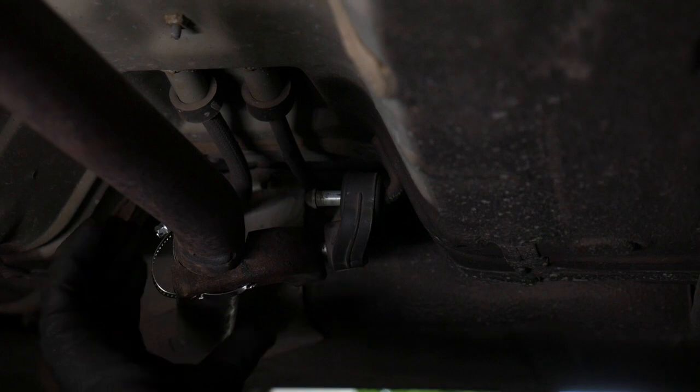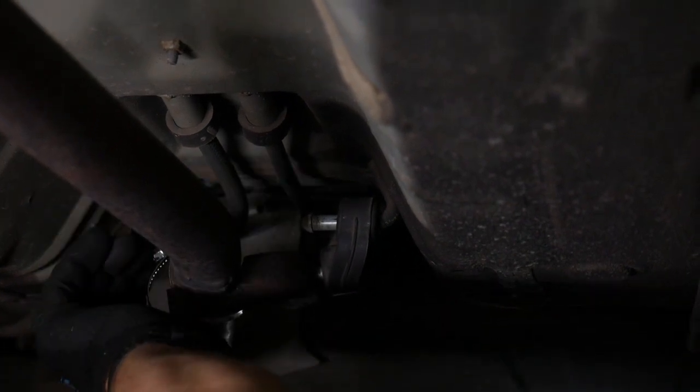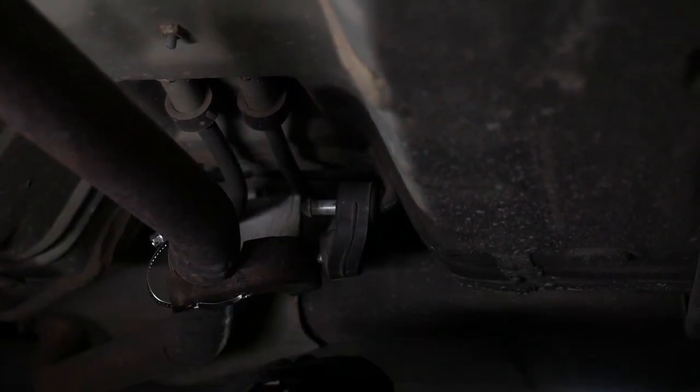The clamp is obviously made out of metal so it's not going to melt, and I think it's going to last a lot longer than the original bracket. For this job you could use some wire or something to reattach that bracket to the pipe, but I've found in the past it doesn't get tight enough — it makes noise, still going to squeak and move around too much, and probably break. Using the hose clamp, it's really strong and I think it's probably going to outlast the bracket anyway, so I think it's the best way to do it. If you found this video helpful, please subscribe and I'll see you next time.